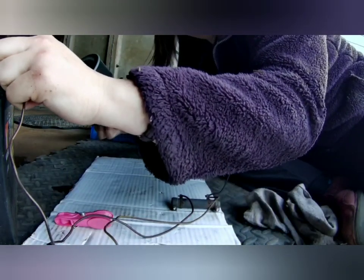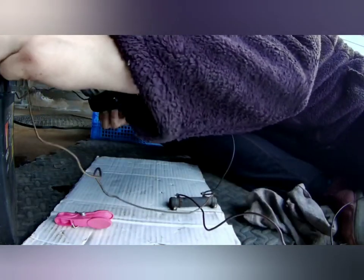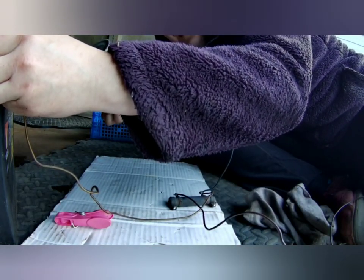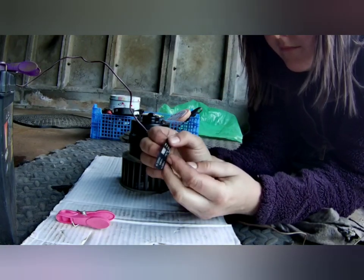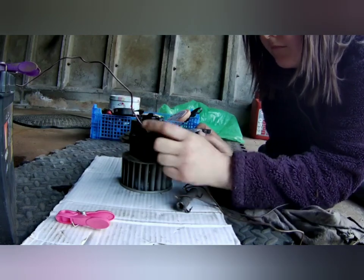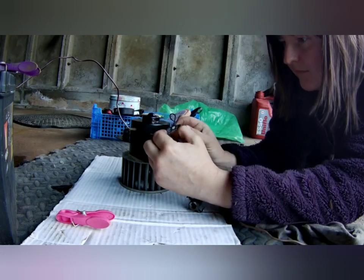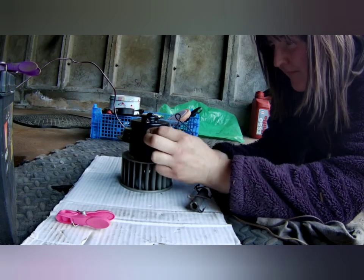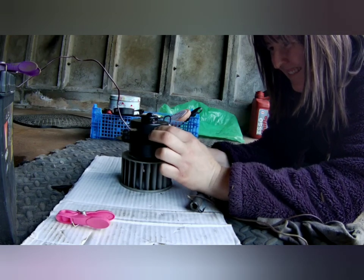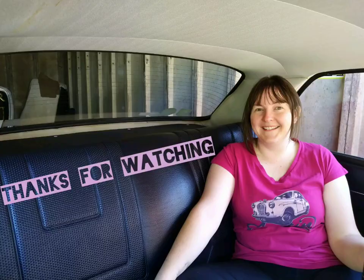Let's put speed two on again - you can see my hair blowing there as well, but more gentle. Speed one again. Fan's good. There's your Smith sticker - this is actually an old sticker. See that's the positive - the single line without the resistor is positive. I checked and it is spinning the right way, so put the sticker on so the arrow pointing to positive is pointing towards the single wire there. Because whatever way we've got this set up now, the fan is spinning the right way. And there we are - thanks for watching, bye.